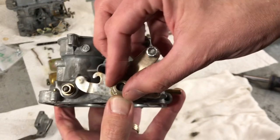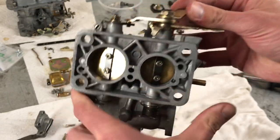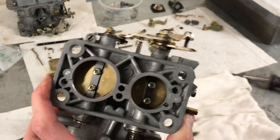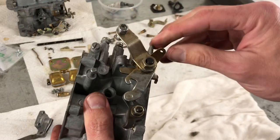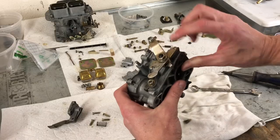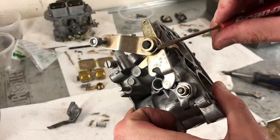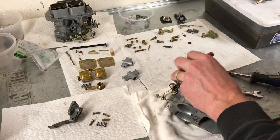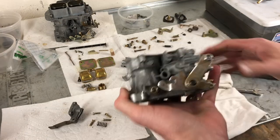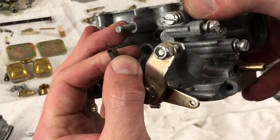Then we have the nut. Once it's hand tight, we just want to make sure we have good working properties of the butterflies. We'll tighten this down, making sure it's not too tight but that it also lines up flat with the locking washer so we can bend that over into the nut. Once tightened down, take a small screwdriver and tap this washer up against the face of the nut. Once it is bent, then you can use a punch. Finally, we're going to take this spring that has two eyes and hang it off of this linkage, connecting it to this linkage right here.